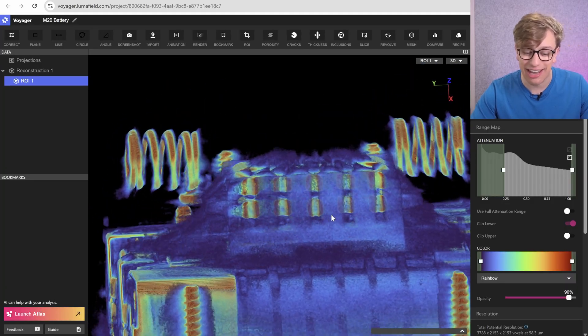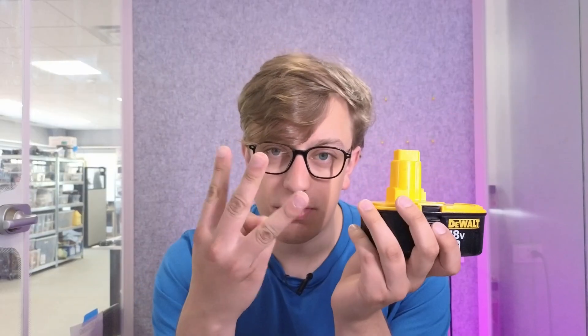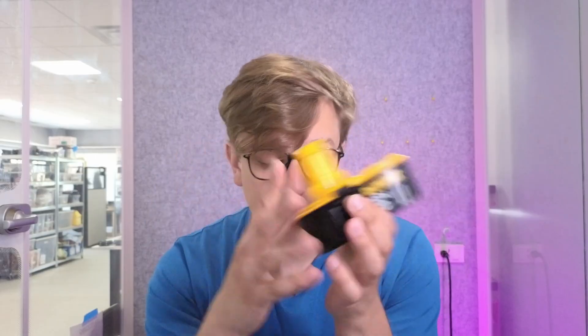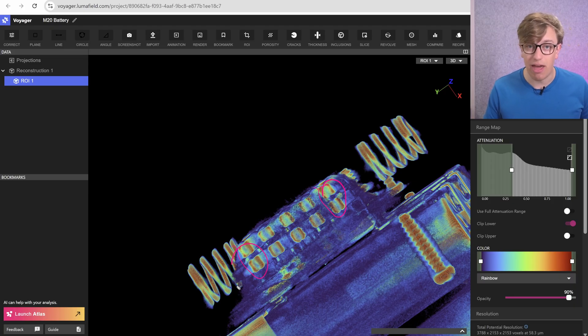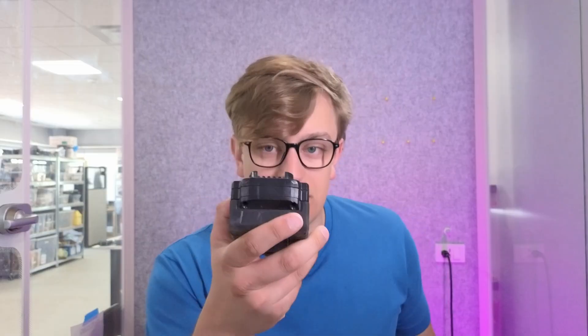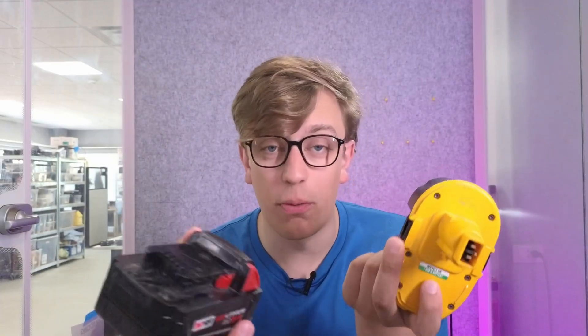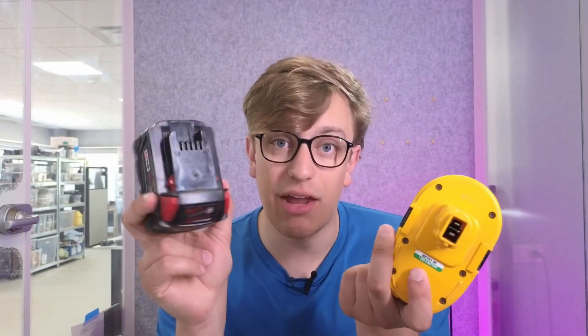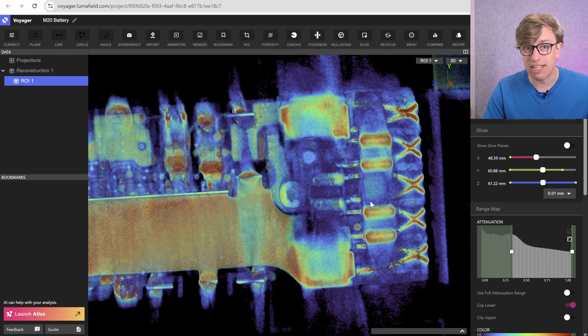What's all this other stuff on top? Let's look at the connection from the battery to the tool. On our old school batteries there are three pins — positive, negative, and thermal protection. On the modern one there are 10. The outer groups are just delivering current — those are hooked up directly across the leads of the battery and let you get an ungodly amount of power out. This blade style of contact is actually a lot nicer to work with, and almost all brands, except for Ryobi, when they switched to lithium batteries moved to this style just to get better energy delivery. You can really see that borne out here.